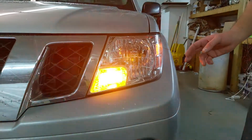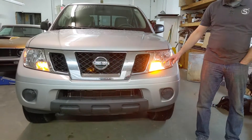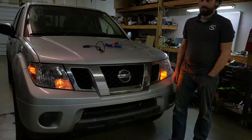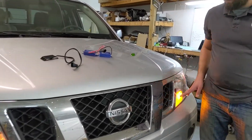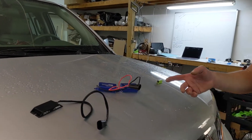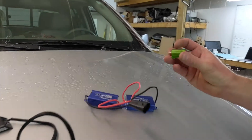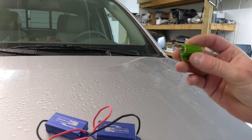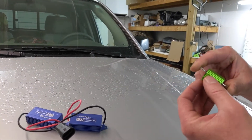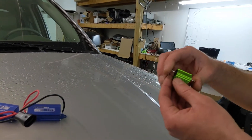Now to fix that, all you have to do is put a resistor in line with the power circuit for the turn signal on every corner that you use an LED bulb. To remedy the issue of hyperflash when you've used LED bulbs, three common options are: you can get these cheap little wire-wound resistors. They usually come in either gold or green — it's just a big winding of wire inside a metal housing, and it acts like a halogen bulb in that it produces extra resistance.